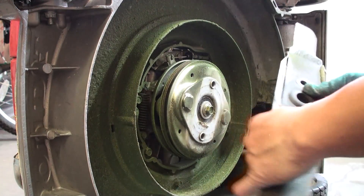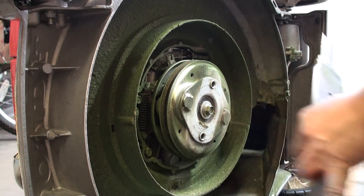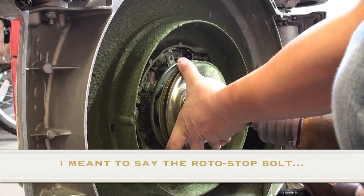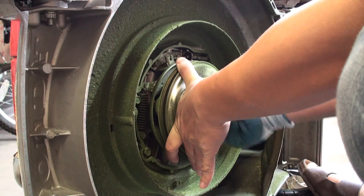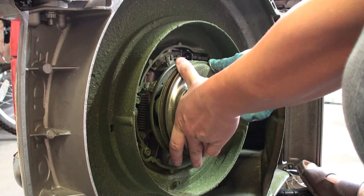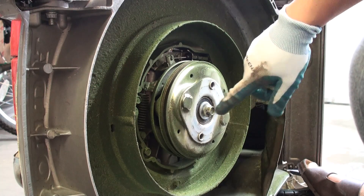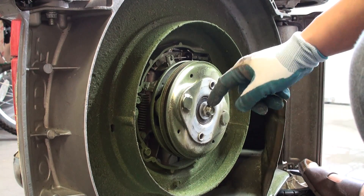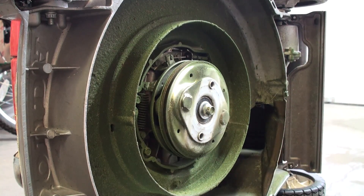Note the orientation of the blade when taking it off — the dish side of the blade is pointing out. Now remove the flywheel retaining bolt, but don't completely undo it just yet because there's actually a spring underneath this assembly. By keeping the screw in partially, it prevents everything from blowing apart when the assembly gets unsprung. Use a rubber mallet and tap it until it comes out.